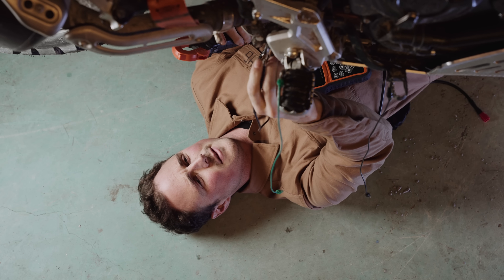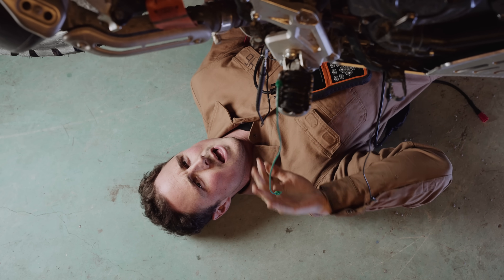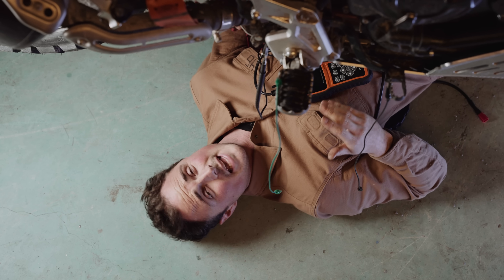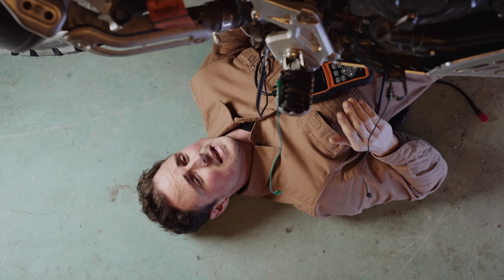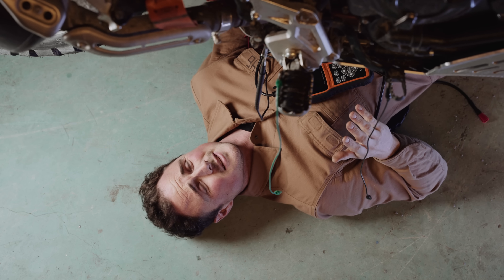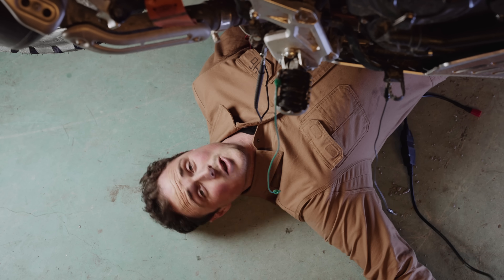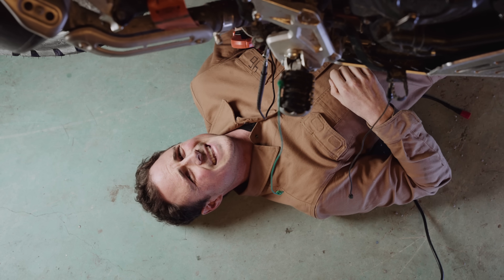The scope is definitely the move. It's just so nice to be able to visually see the signal on a graph. Some modern European bikes are moving toward CAN bus signals, which communicate via a CAN bus data line. But the only way to diagnose problems with a system like that is to use a dealership scanning tool, or just buy a new sensor, swap it out, and hope that was the problem — which is kind of a letdown.